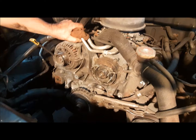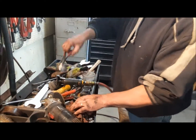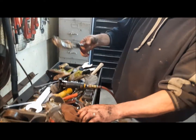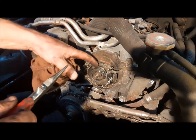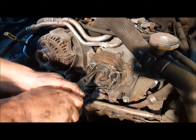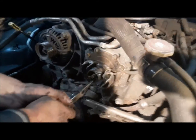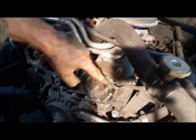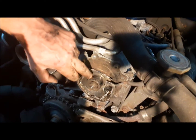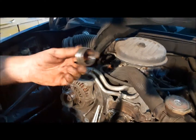After much butcher work and debauchery, I had to resort to cutting the clutch away so I could get to the point where I could split this bearing and get it off. Now we have to look if there's anything left of the hub on the actual compressor. It's actually not too bad — I did leave a little mark in there with the grinder from splitting this bearing, but it's okay.